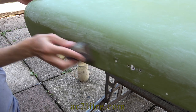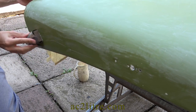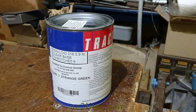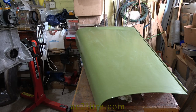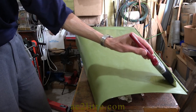Then we come to the serious business of applying the colour. I have to thank Avenue Paints for getting the colour correct for me. Their version of the discontinued Tekeloid brand is much better than another version I originally tried. After a two year break, the quarter-full tin I opened had no skin or hardening and only needed a slight stir — therefore no filtering is needed, which I really hated to do previously.